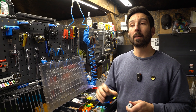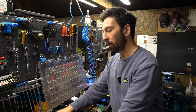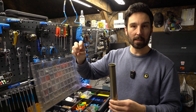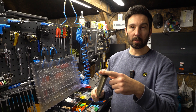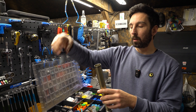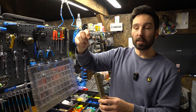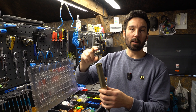So what are they doing? They are reducing the amount of available volume that your air spring has. In the positive air chamber of your air spring, there's a positive air chamber that supports your body weight and the bike — the sprung mass. That pressure sits against the top of the piston, between the piston and the top cap of the fork — that's the bit you squash like a balloon. Volume tokens or volume spacers allow us to tune the available volume of that air spring.